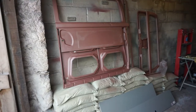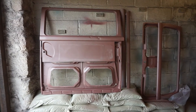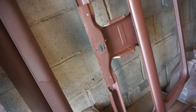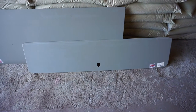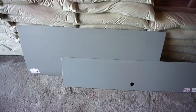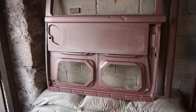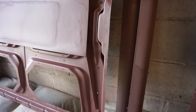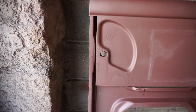Here are the two doors — the rear hatch and the sliding door — and as you can see they've both had the outer skins cut off them and they've been shot blasted and epoxy primed. The rear hatch has got a bit of rust that needs repairing on it. I've actually got a repair panel that I've made up that's going to be welded in, and there is the new outer skin for it. The one behind it is the outer skin for the sliding door. As you can see with the sliding door, the repair panel only comes to halfway, but I've cut off some more of the top part of the door to be able to shot blast behind the lip, so I'll have to make some repair panels for that.